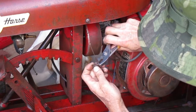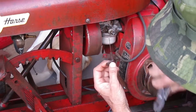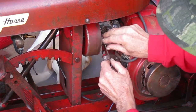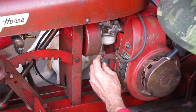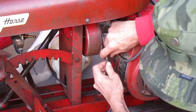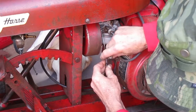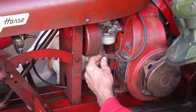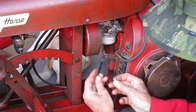There's a notch inside of these cable clamps. You want to squeeze that round part so the notch lands in the groove of the cable jacket. If that notch is in the groove of the cable jacket, you can rotate the clamp around the cable to make adjustments, because it moves up and down like a nut on a screw thread. I try to use all the old parts, but this screw's getting replaced because the slot's wallered out.